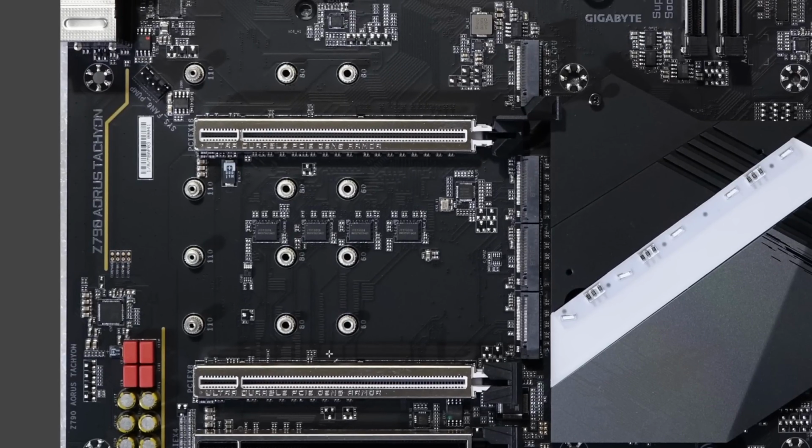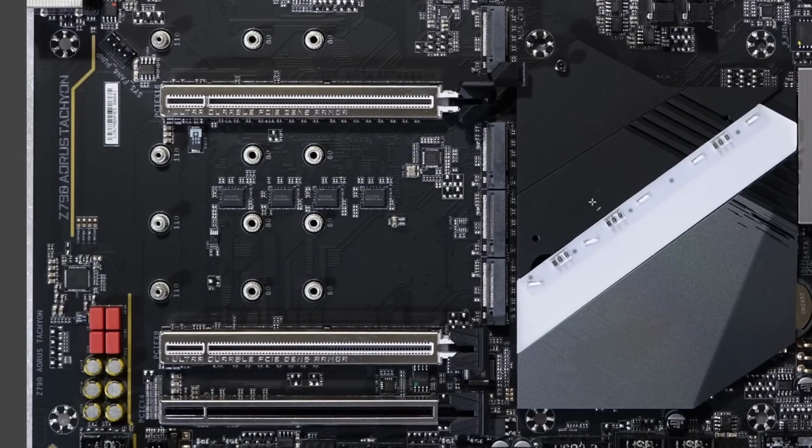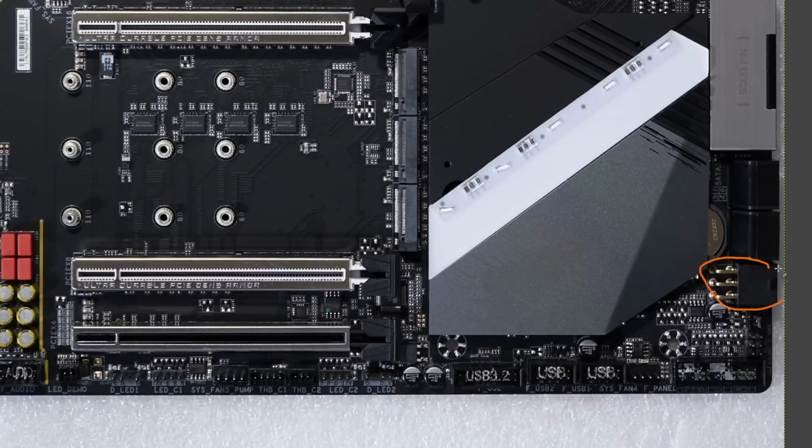are other cards with a sensible amount of PCIe slot power draw, say 50 watts, which isn't really that uncommon. But if you only have two 50-watt cards, as in cards that pull 50 watts from the PCIe slot itself, that's not going to overload a 24-pin. You'd need 3 or 4 of those before it starts becoming a problem. So this connector is kind of pointless, but it also doesn't hurt anything by being here.